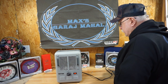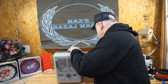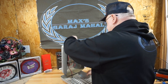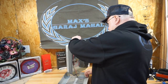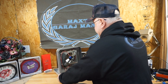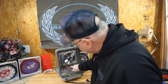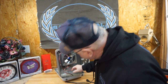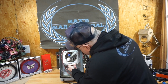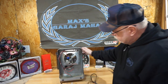We're going to unplug it for a moment. We're going to take the back off with all these screws so I don't keep scratching my nice workbench. We're going to set this thing in here, turn it into a stand. This thing is not very clean inside — I'll clean it out. The momentum weight is working just fine, but it is not moving that switch. It's not interrupting that switch like it should.